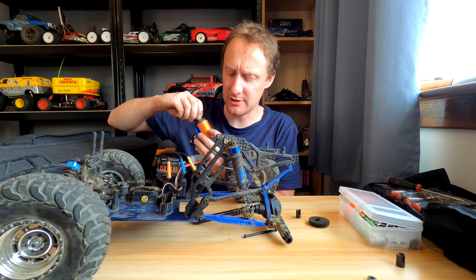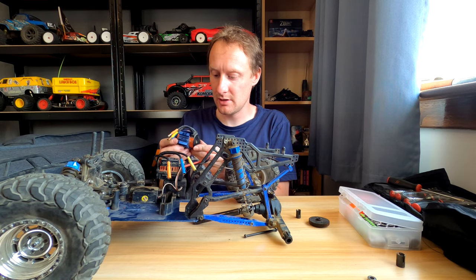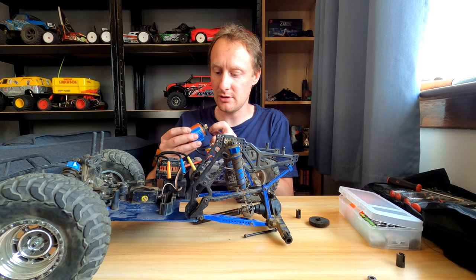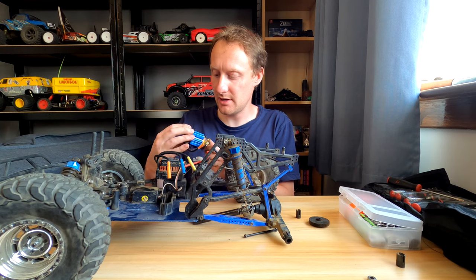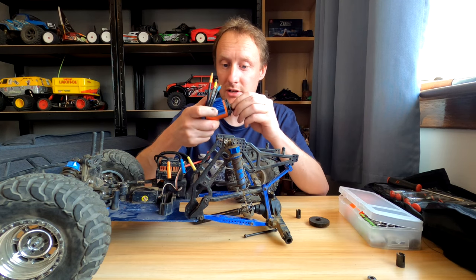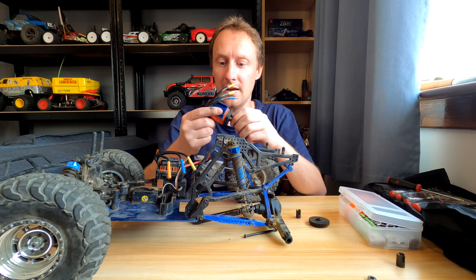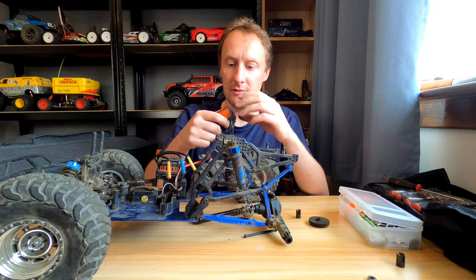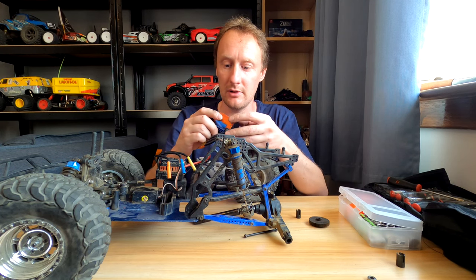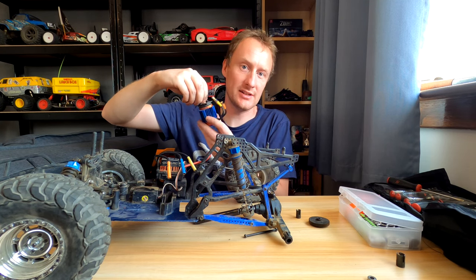Motor doesn't sound fantastic, if I'm honest. But I have had to rescue this motor once before. It's supposed to be waterproof. It's more sort of splash-proof. And after I used this through a few puddles, it actually seized solid and I had to work it free. And unfortunately, the screws on this, Gull RC is cheap. But I like Gull RC. I think as far as really cheap brushless systems go, they're the best of them. Yeah, the screws are cheese soft, so I can't get this off anymore. They're absolutely rounded off, so this motor's here as it is forever now, and if it ever fails and needs rebuilt, that's it. It's game over.